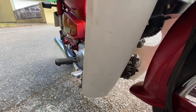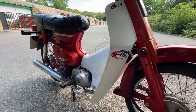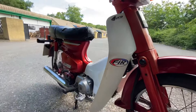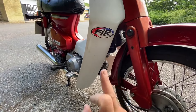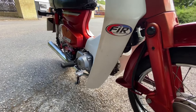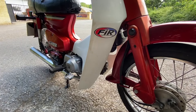I can take the head off and try to sort it — maybe helicoil it — or I've got replacement engines at home, but that's not the point. This bike was meant to be my go-anywhere fallback bike. The tappet adjuster had been tightened so tight it had actually sheared along the threads — it didn't actually split, somehow. There was also no air filter in there. I don't really care about that, but don't say something's been done when it hasn't.